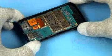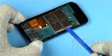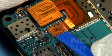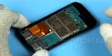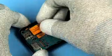Continue with the lower assembly. Use the SS93 for opening the flex connector of the camera flex module. Do not apply pressure at the components while opening the flex connector. Lift out the camera flex module now.